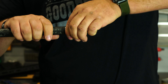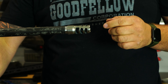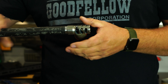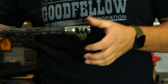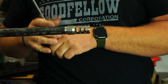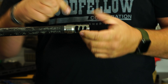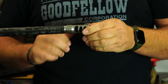Then I tighten this nut really good — you can do this pretty well with your hand. If you have a screwdriver that can fit through the ports, I recommend using it to index and torque — just like that. Don't push against the material inside; just use it to index. Now it's straight up and down, perpendicular, and it's not going to come loose. First I indexed the nut, then I indexed the brake over to fit.